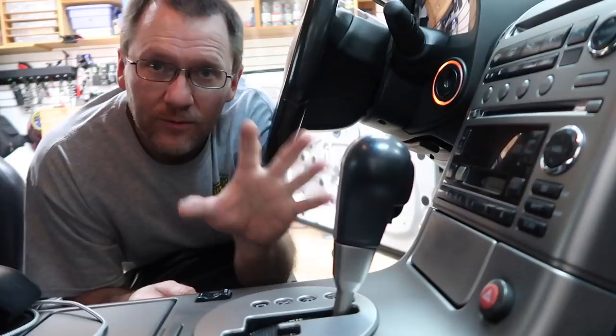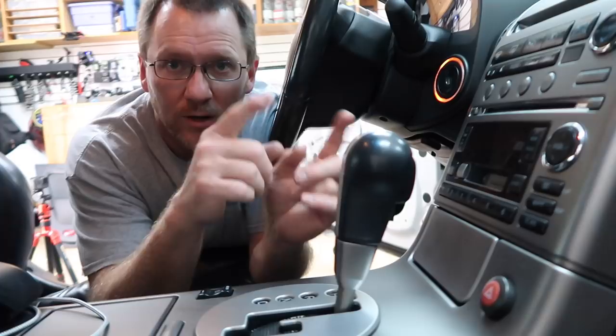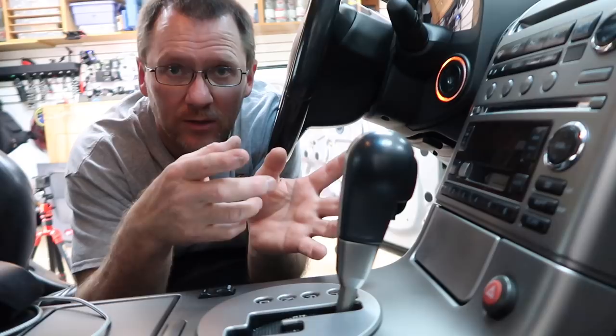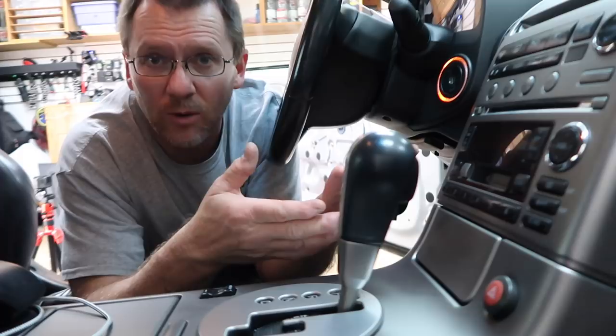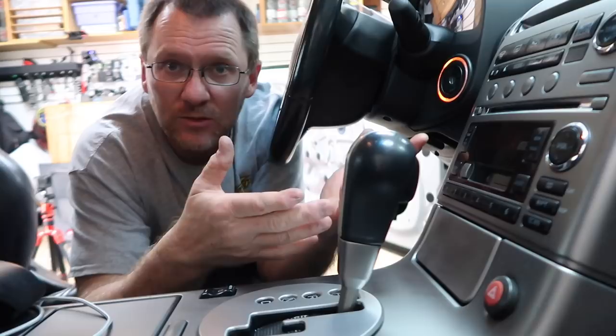There you go. Now, step number two is we're gonna pull the radio out and we're gonna put a T-harness behind it so that we can run the speaker wires coming from the radio back in the back, which will be our high level input, and then forward back into the speakers as a normal high level to low level system would be. We're not gonna be using really big amplifiers in this. This is more to test the DSPs because most of the DSPs nowadays are gonna be high level input because no one wants to change the radio. And his dash looking the way it is, the kits they make for this suck, unless you get the JDM. This would be the perfect car to do it on. Now we're also gonna be running a 4-gauge into a distribution block so that we'll make a panel where all this stuff is gonna be accessible. So it's gonna be like a lab. That's the plan.